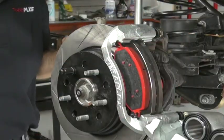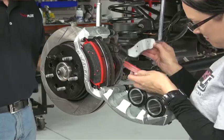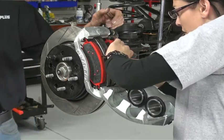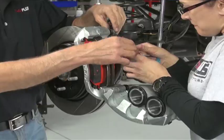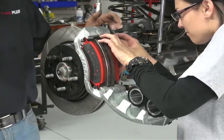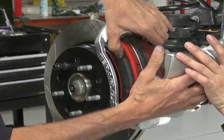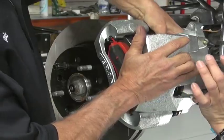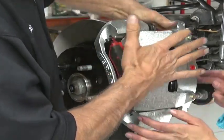Let's grab one of those pads and slide them right into the caliper mount. The clips on the end are a little unusual — they actually catch on the outside and hold the disc pad away from the rotor. You just slide them in and that's how they go. Go ahead and slide the one on the back side. You notice she did one thing wrong here — we always want to have the brake pad against the rotor and not the metal surface of the disc pad. Turn it around. Slide the caliper back up into position — you're going to have to pinch these together because that's spring-loading them out of the way.